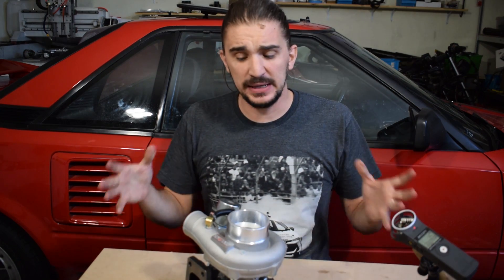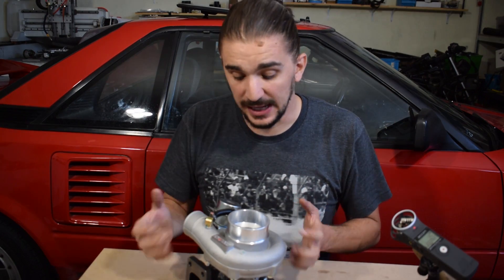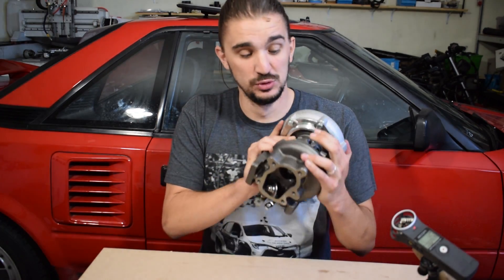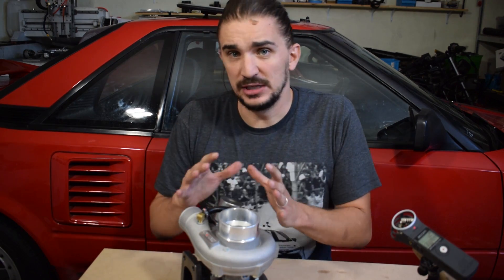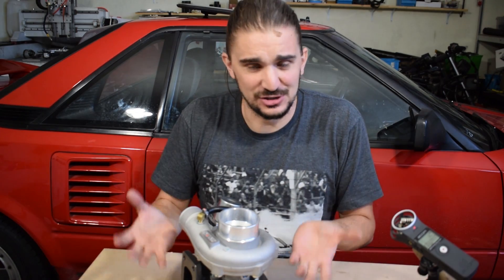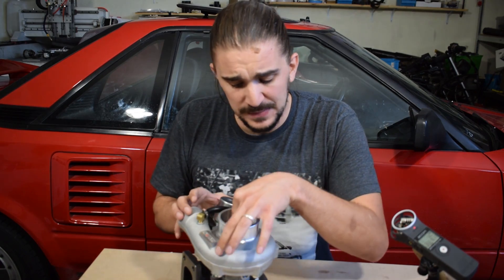So here's my plan: I'm going to start out with a turbo on the big side. If I like it, I'll keep it and have fun with it. If I don't like it, I'll replace it with a smaller turbo. We're going to see what this thing can achieve — whether it can get me to the desired 300 horsepower with my 1.6-liter 4A-FE engine. Once I've had fun with it and thoroughly tested and abused it to get data on how these budget turbos actually perform under high boost, if I do like this turbo size I'm going to replace it with an actual Garrett for a bit more boost, more power, and faster spool. I honestly think at low boost around 12 to 13 psi, this thing can live all day long and will be durable.